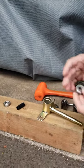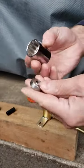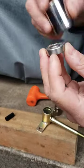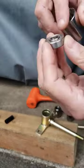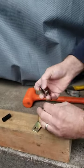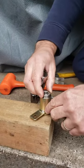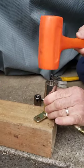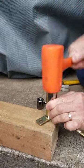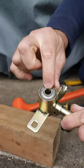I did not put it in the freezer because I know it's going to fit into this knuckle no matter what. I'm going to use this socket — the inner race will fit inside of it — and I'm going to hammer it down using the big outer race, not the small inner one. Put it on a wooden block; that would be the best way, and then with a mallet you can hammer it down. It goes pretty easy and I did not damage the inside smaller race.